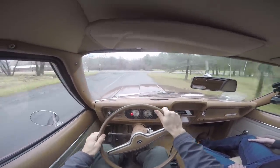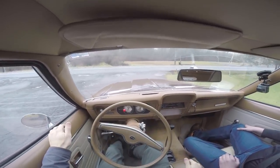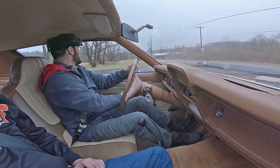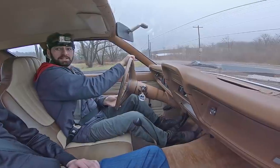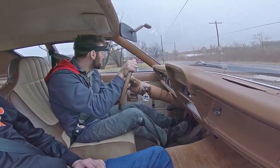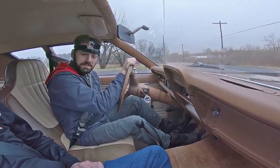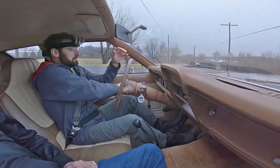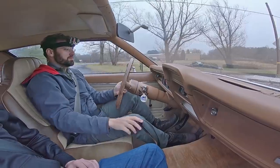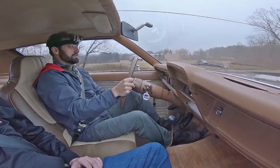Okay, I want to go out Adamsdale. Sure. Pulls to the right, really pulls to the right. Look at that. And adjust the brakes a bit. Definitely favors the right side. Yep. Grabby. Drums. All right, let's see how easy I can take it out. Felt I might have needed more gas. Just second up there. Didn't need to rev it into second.